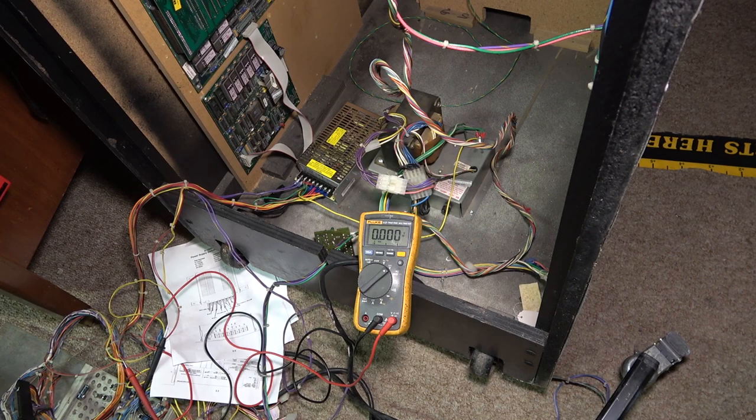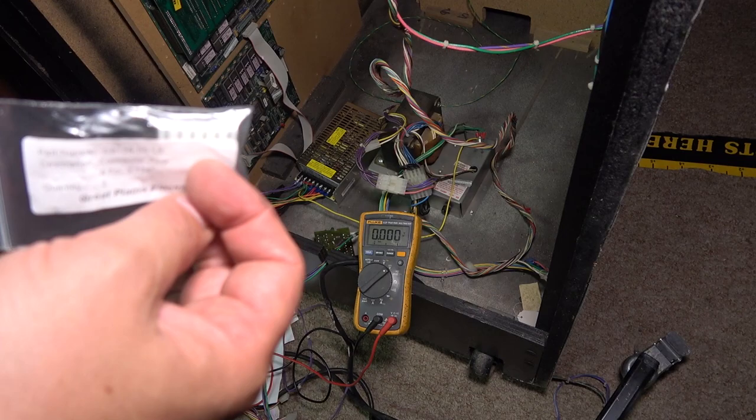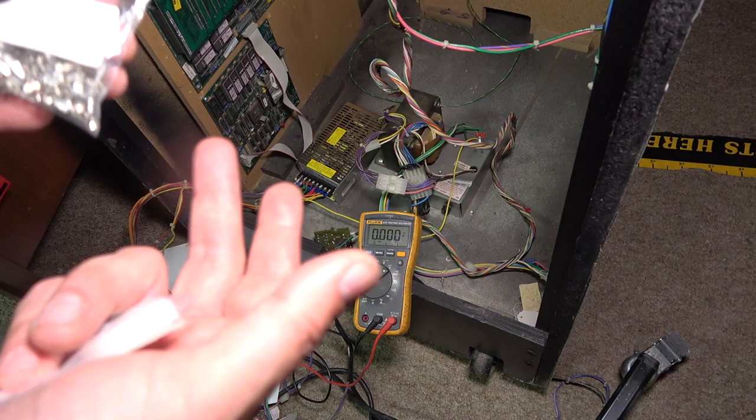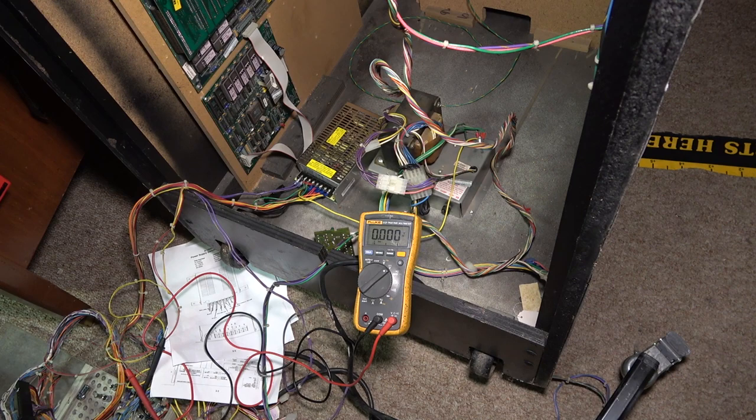All right, game's off. So now I've got to crimp the video cable. So let's do that. I have some connectors here. Where did I put it? From Great Plains Electronics, this is a 0.156 6-pin connector. This is where I buy these Molex type things. And then I also have the pins for it, which are these Trifurcon 0.156. The Trifurcon kind of grab onto the pin a little bit more. It's kind of the pins you want to get.